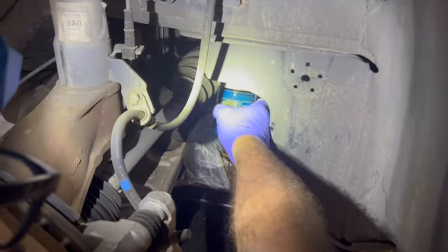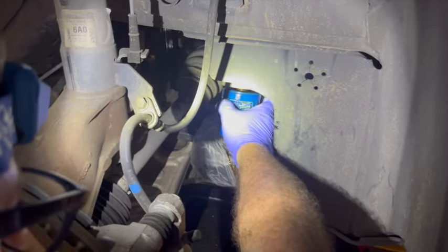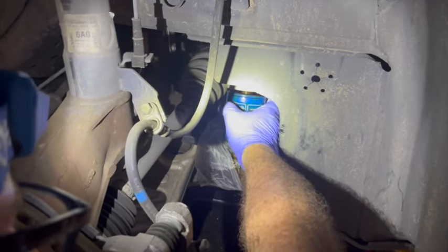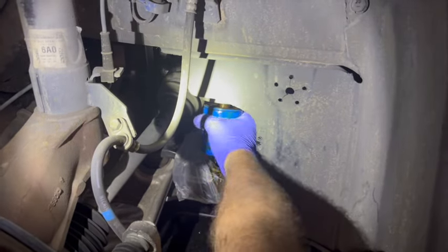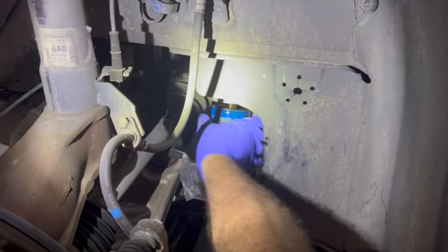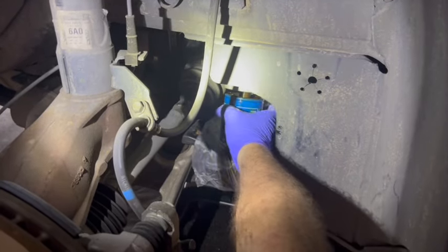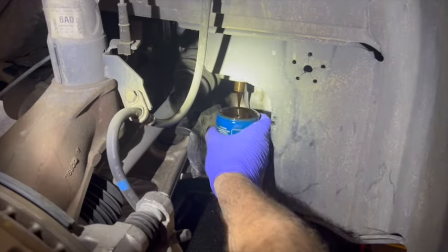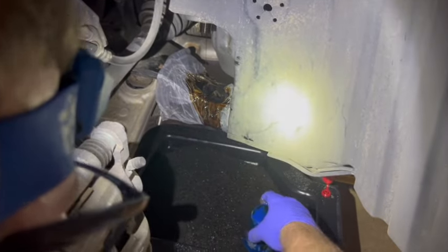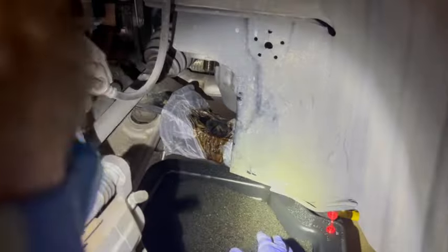All that's pretty much done. If you just back off for a couple seconds, that little bit drains right out and I can finish spinning this filter off. By the way, I always do this when the oil is warm — the filter has some heat to it, makes your oil flow nice. Then I just turn the filter upside down in my drain pan to get it to drain.